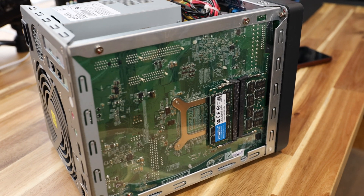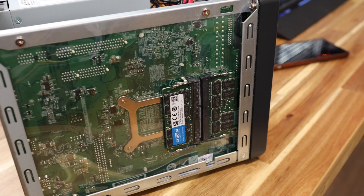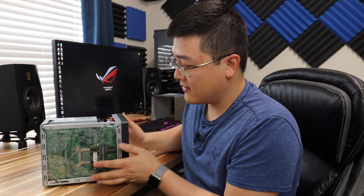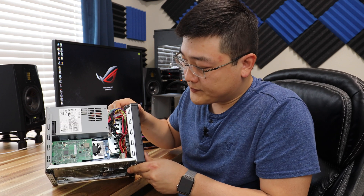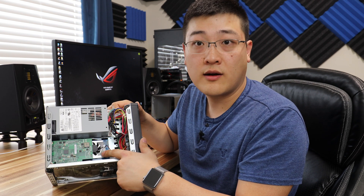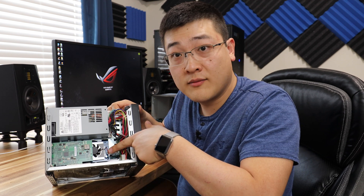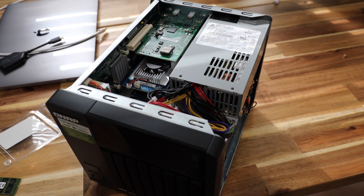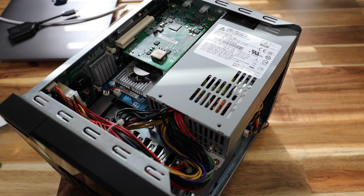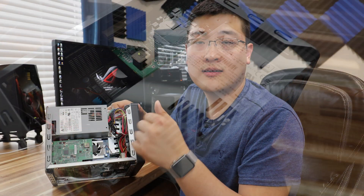What you've got here is an i7-6700HQ Intel processor with your memory modules right here. You can see the Intel bracket right here and up here on the other side, you've got your Thunderbolt 3 card and your Intel 10-gigabit network card. I've actually disconnected the fan module for this card and this is because this fan is a little bit on the high-pitched end, and basically all of this space is an Intel X550 T2 network card.